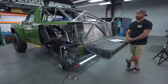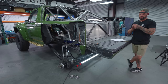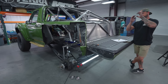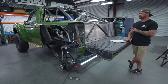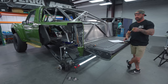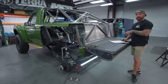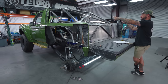We had to figure out how much up travel we actually want because the driver-side diff wants to compress way more than the frame allows, and up travel is limited by that first, then by the drivetrain joints. With Jason we had to go back and forth on how much of that frame we actually want to remove — at some point you're removing so much that there's only an inch left and you're building structure on top of it. So we're going to let it bump as extreme as it can in the front and make extra provisions to supplement structure into the chassis. The cross member and everything from Jason will come as a sub-assembly — like the F800 — with pivots, rack mount, and swingers all in one part, then we plug it into the frame and it's done.